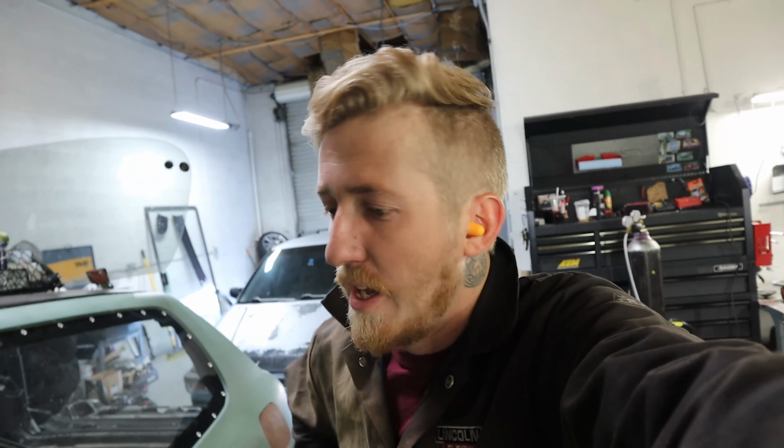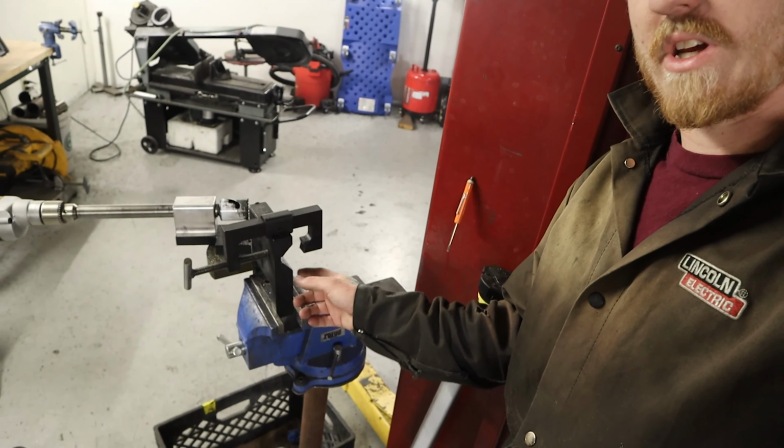Of course, this does not change my review on the cage itself, because the ladder half of it, these door bars and main hoop assist bars and stuff, that's all stuff that you have to adjust yourself. It's just cut extra long so you can do all the notching, and obviously having a good tube notcher works really well. I use the JD Squared tube notcher right here, and then I just found a 1 5/8" hole saw bit at Lowe's because Home Depot doesn't have them in store.